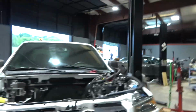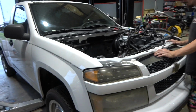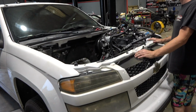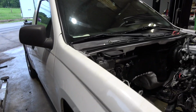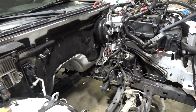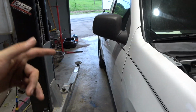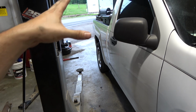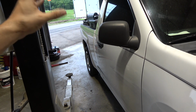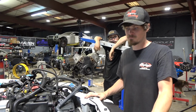All right, so just a quick little update here on the Colorado. We've got Mason over here spearheading this build. This is our shop truck build. You guys have probably seen this on the channel before. It is fully spec'd out, with the badass Fab catalog on this thing. We've got their Caltrack set up, stock suspension in the rear, stock rear end, but lowered. We've got their coilover conversion on the front, and their entire catalog to do an LS swap with their 5-speed upgraded clutch kit.